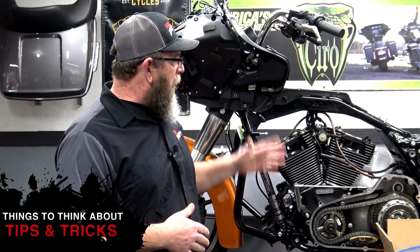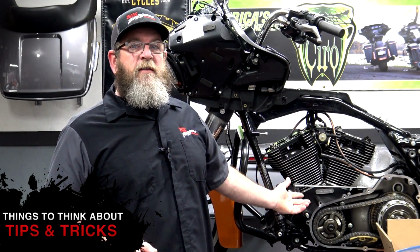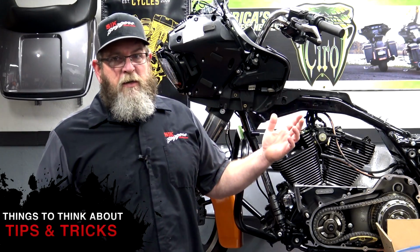It makes no sense to me to have all these brand new black shiny parts and I get them back from powder coat and I'm gonna stick them back on a filthy bike when I've literally had like a week, maybe 2, to get in here and clean all this stuff up. It's a good time to go ahead and address the wrinkle black on the motor. There's several products on the market. We did a video. I'll put the link down in the description. We compared the S100, the pig spit, and the Harley Davidson engine brightener. Go ahead and dress all of that while you got this apart. So when you get your parts back, you're pretty much going to have a brand new bike after you put it back together. Trust me, you'll feel better about it.